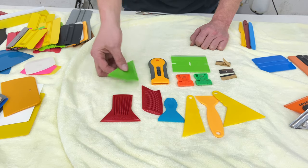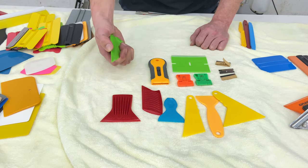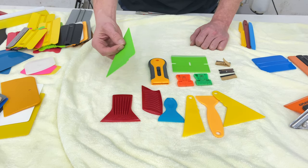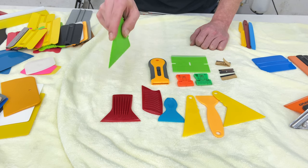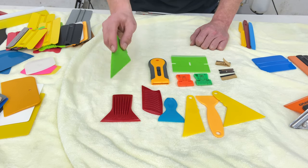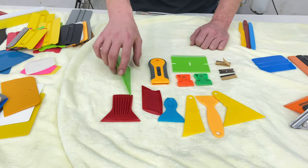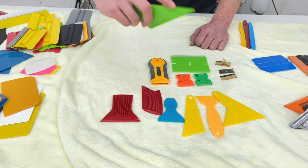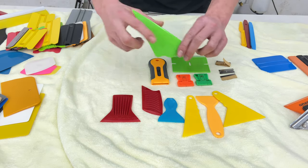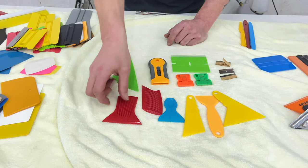This is a corner tool, however it's a very hard, very sharp green corner tool that can scratch tint very easily. It's great to reach really far in and use light pressure, but definitely not something you want to put heavy pressure on window tint. I have found that it makes a fantastic quick window tint scraper — I've used it this way on the window and that way on the window.